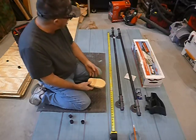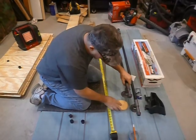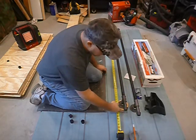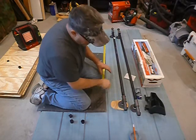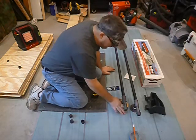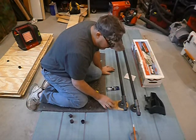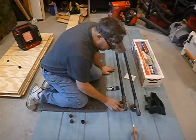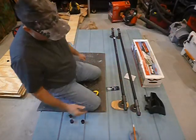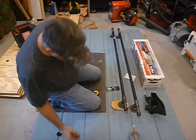And then I'll fiberglass them to the top of the camper, and then this will screw to the top of that, and I should be still under my 60 inches, and that way I don't have to run the screws directly into the roof of the camper. I screw it in here, and if this ever starts to rot or delaminate, a little moisture gets in there, it's not a big deal. You can just grind off your fiberglass, take that piece off, put a new piece in there, bolt it back down. So now you got a sacrificial piece for your camper top, so you don't have to worry about your camper leaking.